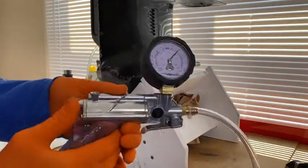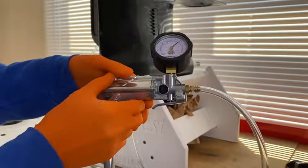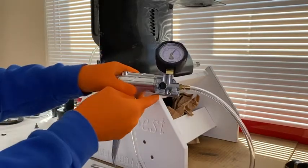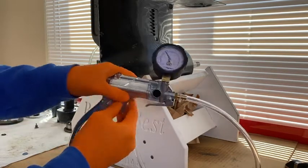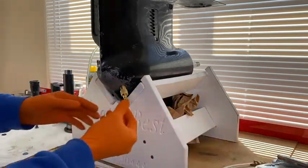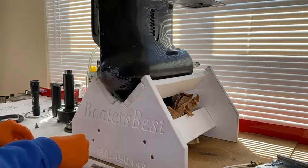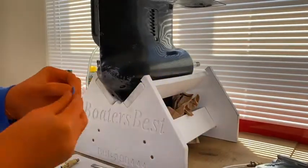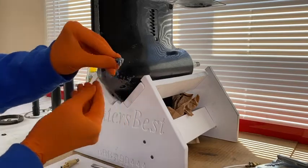DIYers, we're back at it with gloves on. Here is the pressure gauge — deadlocked at 15 PSI. That is a successful pressure test. We'll press the pressure release valve and drain all the PSI out of the case. Once it zeroes out, set the pump down and remove the fitting. Now carefully unscrew the adapter from the lower drain port and set that aside. I went back to the OEM style gaskets as opposed to rubber.